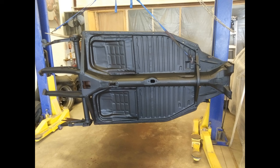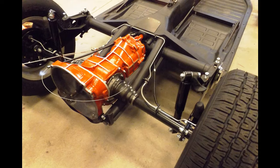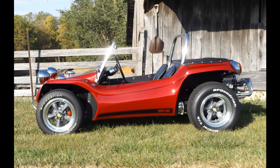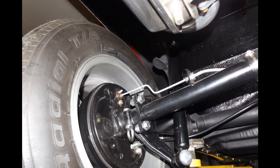The pan was completely refurbished, eliminating all extra old build mounting holes and imperfections. The center spine was skinned for strength and the pans were replaced. The original molded-in channel on the rockers was replaced with rectangular tubing, making it a much better fit to the body and a rock solid platform as a base. The rear mounting area of the original pan was raised 5/8 inches to allow clearance for the dual IDF carburetors. Bodies are often cut for this reason. The added rake on the body also adds a slightly more aggressive stance without changing ride height. Both front and rear suspensions are adjustable to allow for individual preference and to keep the rear swing axle camber in check.